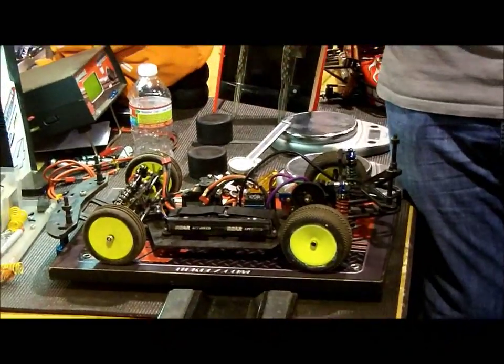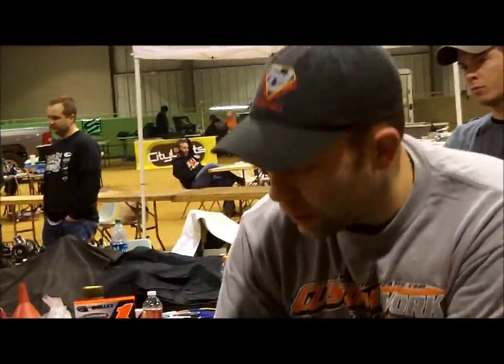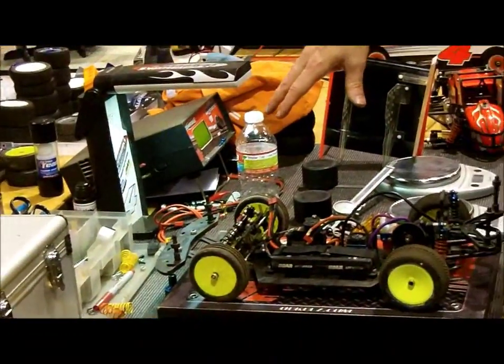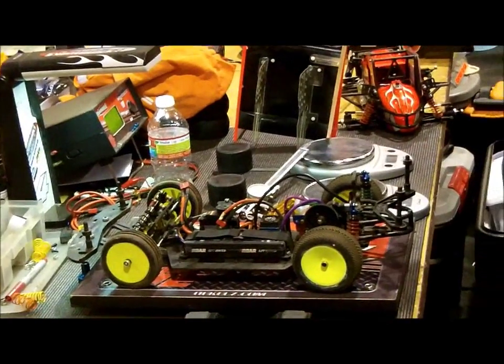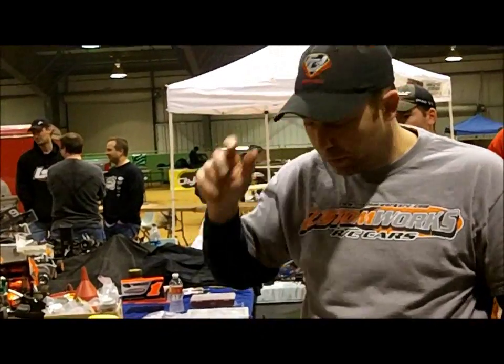They've already got the collars everything's preloaded out. So when you turn that collar down and you raise that corner, you're raising the corner of the car. You're jacking more weight on the left rear. So everything's adding in the same bucket to get tighter. So you're going to get tight. It should be a help.